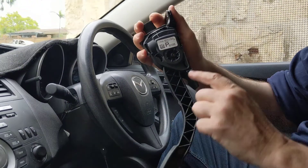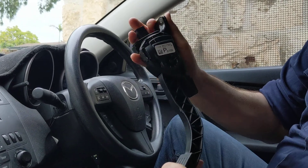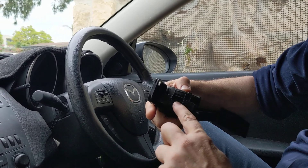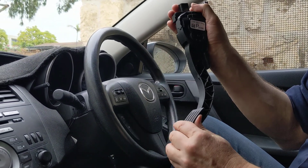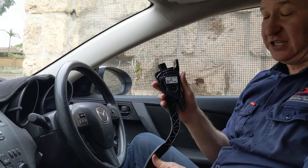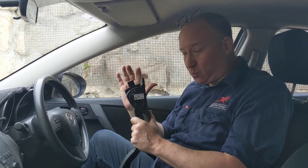This is fly-by-wire — there are electronics, and as you press your foot on the accelerator you're moving a variable resistor, which sends an electrical signal down the wires to the central computer to tell it what position the throttle is in.